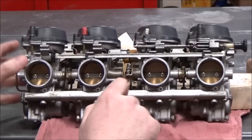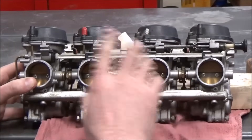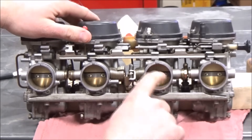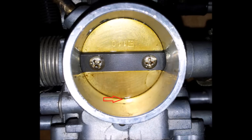On any four-cylinder like this you're going to have three adjustment screws. As we start cleaning carbs, we always want to make sure the throttle plate is in a certain position. Here's a picture of that — you can see where the arrow is pointing. There are usually three, sometimes five, little holes, and many service manuals specify putting the throttle plate just forward of that first hole to get a good baseline idle.